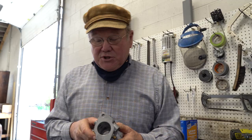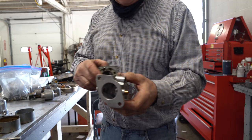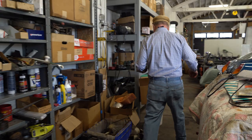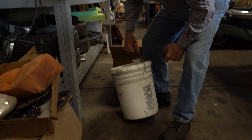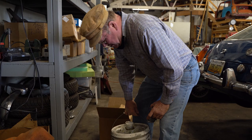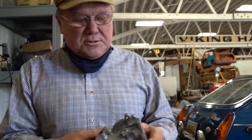So I've shown you how to take your carburetor from looking crummy, sandblast it, put it through the tumbler, and the secret — the secret is the fluid that you use. This stuff is L547. I don't know if that's industry-wide or proprietary from Grand Northern here in Grand Rapids. But if you use anything else in there when you tumble aluminum, it turns black. So the secret to making it look as nice as this is the L547.